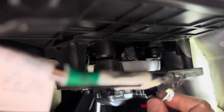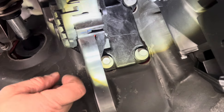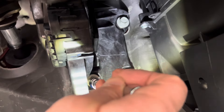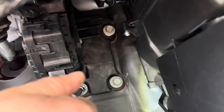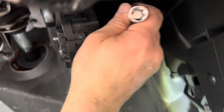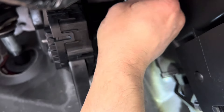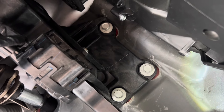Take your connector and push the tab down to lock it into place. Now get your gas pedal back in position. Catch all the screws by hand first — you want to get them all started by hand — then take your socket and run them down. I'll grab my ratchet and snug them all up. I just got them all hand tight so they're seated; they're in there pretty good.